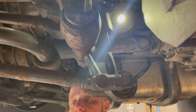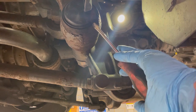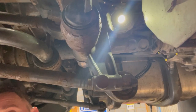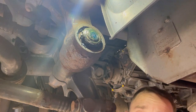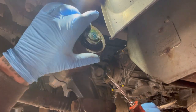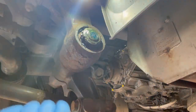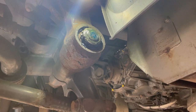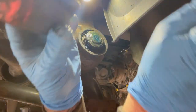we're going to get the cap off first, nice and easy. We're going to use the screwdriver, get the cap off first and then we'll have a look behind it. So hopefully you boys can see that. It's got a washer kind of thing in between it. Somewhere in this gap should be a lug bent over. I think it's that one there. So it's got like a little tab that folds over the nut. So we need to undo that first, get that tab out. Let's have a look. So I can see it. There. So you can quickly get it for you.